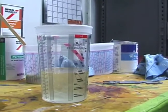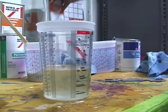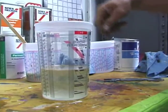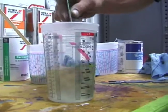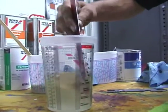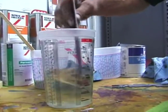The clear has a limited pot life once it's mixed. You have just a few hours to get it sprayed, or it's going to turn to a big tennis shoe sole. So once those chemical components are together, you've just got a little while to apply it.